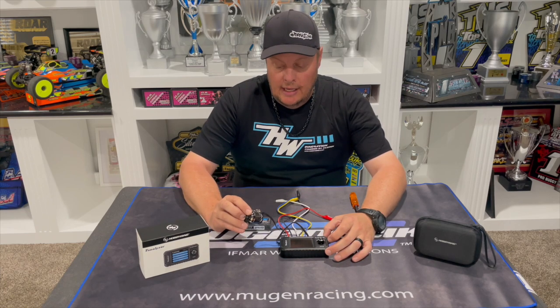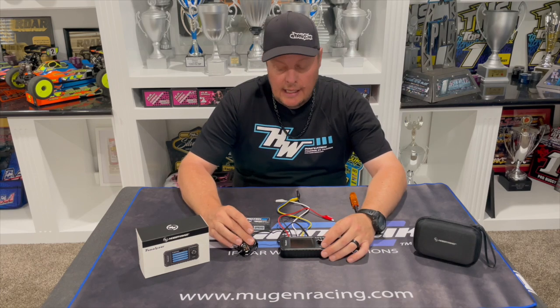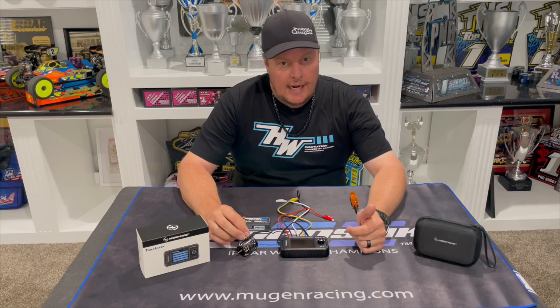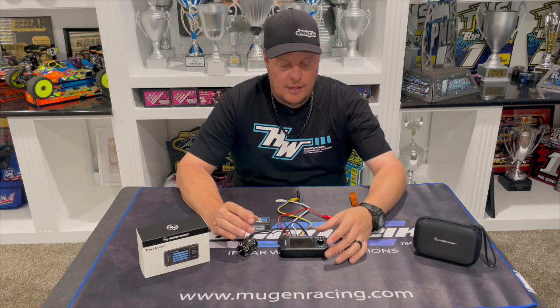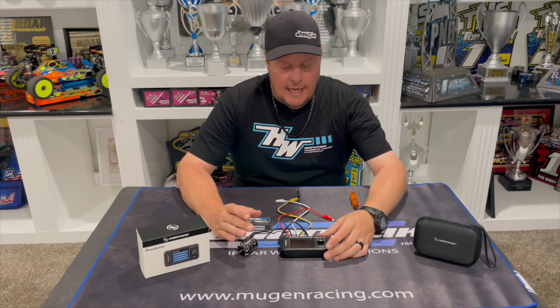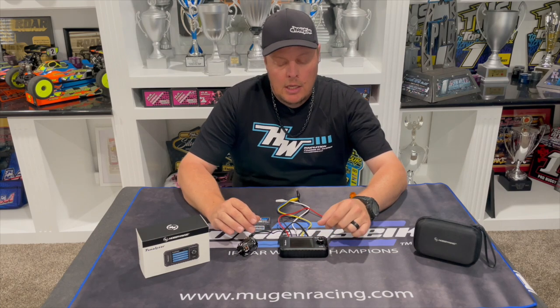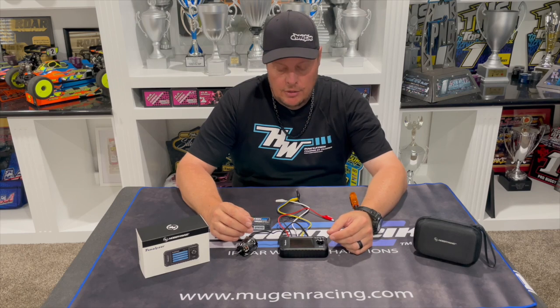What I'm going to go through today is tuning a 17.5 Hobbywing G4R motor. I've been able to run a little bit of stock lately at two different tracks: A Main Hobbies Outback Raceway and HRCR in Hayden, Idaho. With mod motors or 8th scale motors, it's still not a bad idea to have a Tunalizer — you can test your motor when it's brand new, and if you ever feel something has changed, you can compare your numbers from when it was new to where it is after some time. You can do an auto test or a manual test to power the motor through the full range and analyze what's going on.